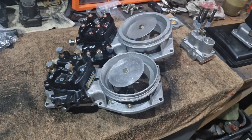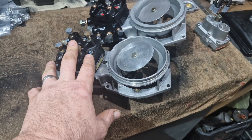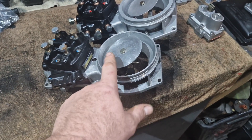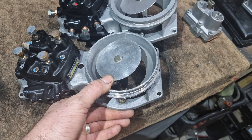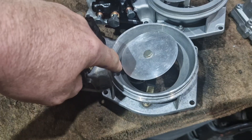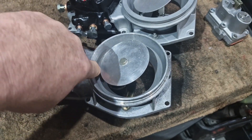So the air has got more free movement of travel to come straight in rather than having to go around a step. I've been wanting to do that because we know what airplates do, but how high do they go in the car? The theory behind how we've set the fuel up has worked on mine. In practice, does the air plate actually go high enough to inject that fuel? The answer is yes — it's topped out. My air plate's probably one or two mil below that maximum. And look — you can get your finger quite tight around the stock one, can't even fit it any further, whereas on the Porsche unit you can go all the way around. So it's definitely proven to work.